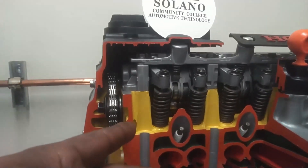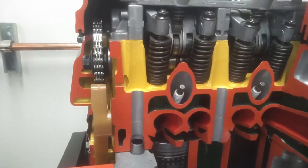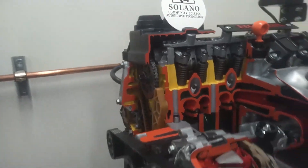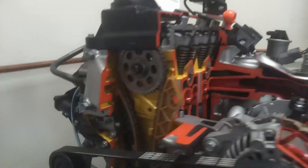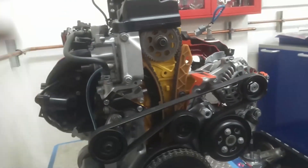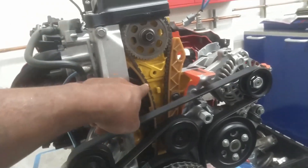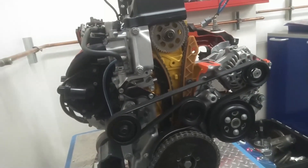So this is cylinder one? Correct. On the Honda, this is cylinder number one, number two, number three, number four. So the exhaust valves are closed — now it's going to have its explosion. The valves are opening because the rocker arms twist with the cam. This engine actually has a chain instead of a timing belt, and it has these guides here. It's super important to keep fresh oil in your cars that have timing chains and plastic guides, because if you don't have good fresh oil in there, these chains rubbing against the guides wear those guides down, and then you start having chain lash, which could be detrimental to the engine.